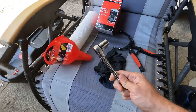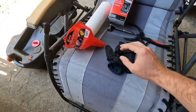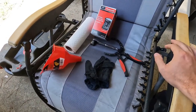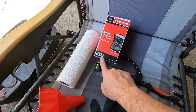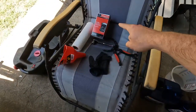You'll need a 16mm socket for your oil drain plug, an oil filter wrench, some gloves so you don't get too dirty, and a big funnel — I picked this up at Lowe's this morning because my other funnel was dirty and I didn't want that dirt going in the truck. You'll also need a FL-2051-S oil filter; I got this at Advanced Auto Parts. I always go Motorcraft with Ford.